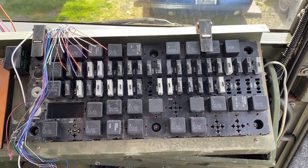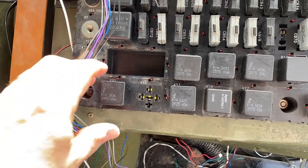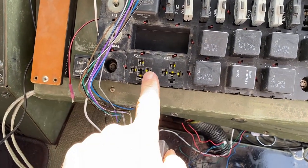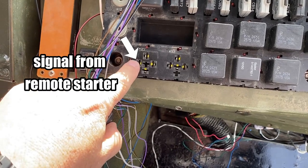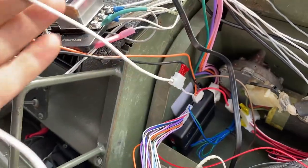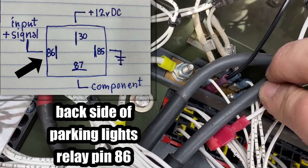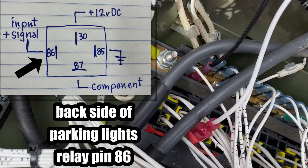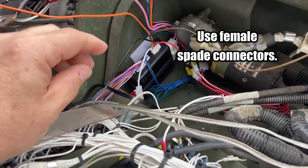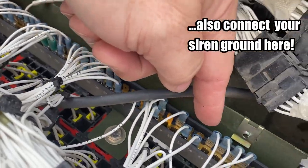Next I want to hook up the parking lights — that's this connector on the 3116. Mine is a 1996 vehicle, so I pull this four-pin connector: this pin is ground and that one is the switch where I need to put power. I'm going to use one of these T-connectors — comes in a set, I'll put the link in the description — it makes it easy to splice right into the wire. The white fused wire from the 5-pin goes into where I put that splice — very easy to use. Connecting the ground wire is pretty easy too, because this whole line is all ground wires.